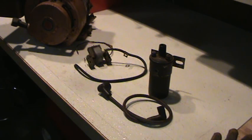The reason that some engines — Briggs & Stratton in particular — get swapped from the internal mag-operated coil to the external battery coil is because a lot of times people think that's where the problem lies. Most of the time it's not. A lot of times it's just a simple cleaning that needs to be done to the flywheel, or the gap has somehow increased. Jarring the engine has caused the gap between the mag and the flywheel to increase to the point where you're not getting an effective spark to ignite the fuel.